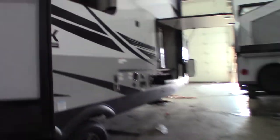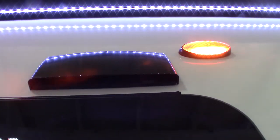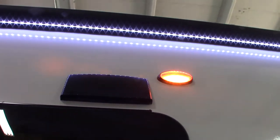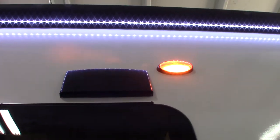Starting on the outside, you have a power awning with LED strip. This vent right here is the range hood vent. Keep in mind there's a tab — a latch on each side. If you want to vent to the outside, you've got to reach up and snap those tabs open so the whole baffle flaps freely and vents to the outside. Otherwise, the air you're attempting to exhaust is just going to bounce back into the trailer.